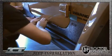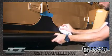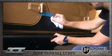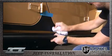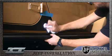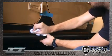Finally, while holding the product away from the vehicle, pull the remaining liner off the back of the panel and work from the top to the bottom, smoothing any trapped air out from behind the panel. Take a rag or soft cloth and briskly rub and smooth the panel onto the vehicle's surface.